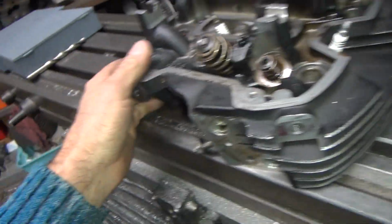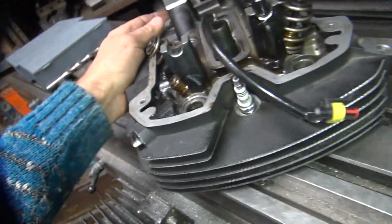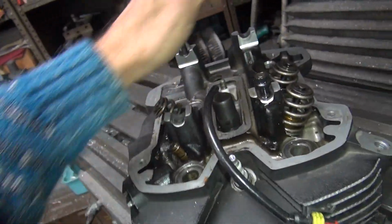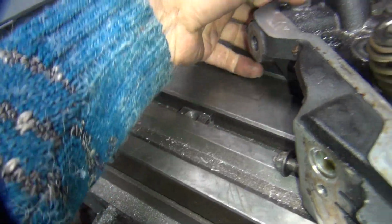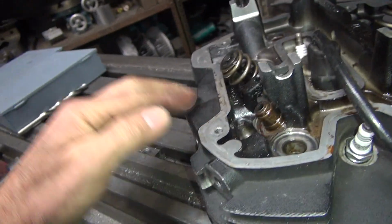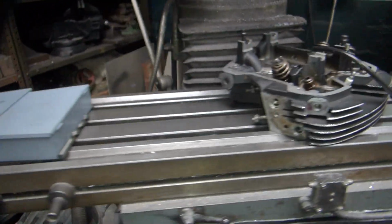So now I got to hold this head down somehow. So I'll cock it a little bit. Appears to be some dowel pins or something in the way. Make sure you're being held flat on the table. Appears to be flat. Feel like this. And it doesn't move around. You know it's flat. Okay, so I can put a clamp right here on solid metal. And I put a clamp over here where it's semi-solid. Or I can clamp it right here. It is solid, right next to where I'm working. So if we move that over a little bit like this, we'll clamp right here, right here. It's right between the part we're drilling, so it's nice and strong.